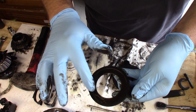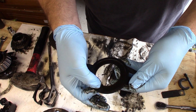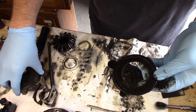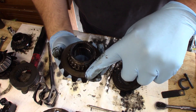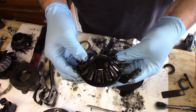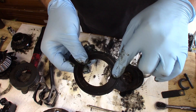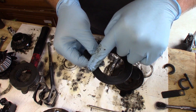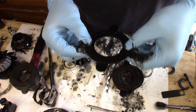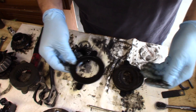You can see how the material is worn away — only about 60% of the actual clutch plate was making contact with the gear. Here's the gear and here's the surface area, so this is the contact that was being made. You can see it just slammed and wore that clutch plate down but didn't touch the outer edge. This is an improper configuration for this 8.8 for that specific reason.